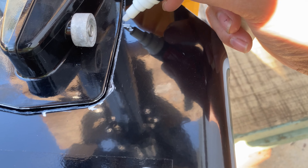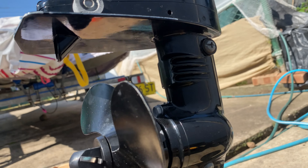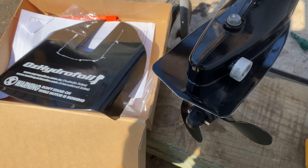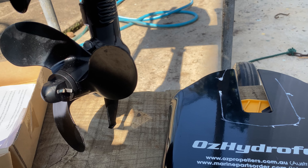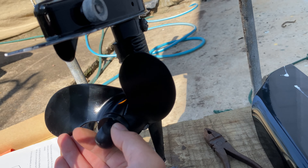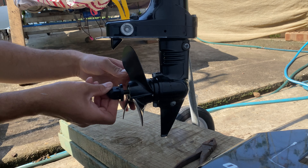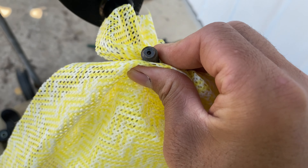I'm just going to run this around and clean it up afterwards with some acetone or something. Dodge in where the fat bits are and we'll work out wherever that is on the other side. I think what we'll do is we'll just pull the propeller off so we can just access it easier. Now's probably a good time to tell you why we're actually doing this — not just for fun, because it was cavitating quite a bit when I was using it. So hopefully this will rectify it and we'll film it to see if it makes any difference. We'll just bend this pin over, pop that out, unscrew it and maybe grease it if it's a bit gross. Disconnect the spark plug — definitely needs a grease when we put it back on.